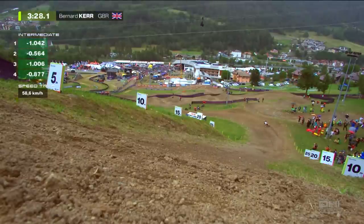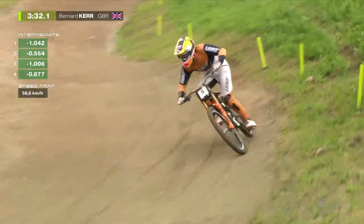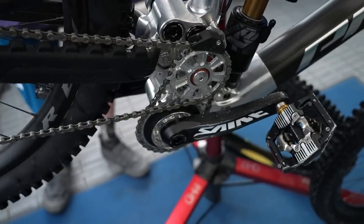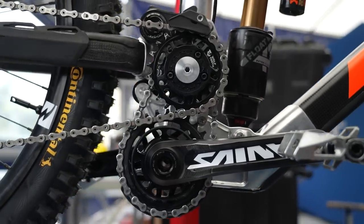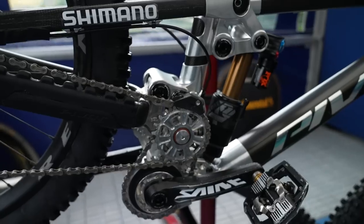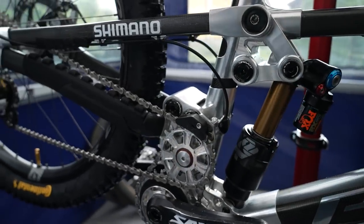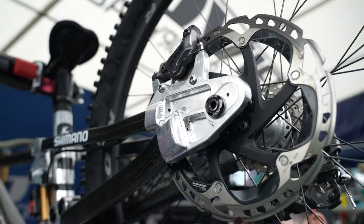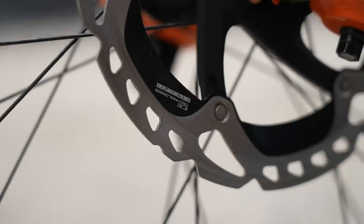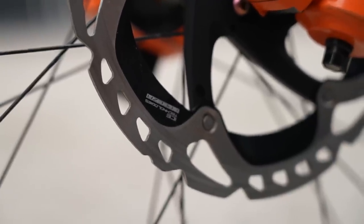Just looking through the shots, it's an awesome-looking bike. That whole DW6 thing — it is essentially still just a DW linkage above the BB that you can see in that rocker, and there's just another link to support the movement at the back end. It kind of is still a six. Apparently that idler is adjustable to adjust chain tension because it's got two chains. The chainrings are custom and they've swapped around a lot of different ones recently, thanks to Wolf Tooth basically flying them in every week. We did chat to the mechanic on Tane's tent who confirmed there is some new fin tech potentially coming through on those IceTech rotors. Watch this space.